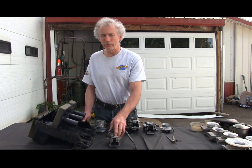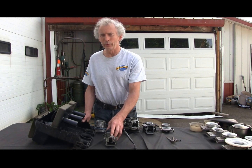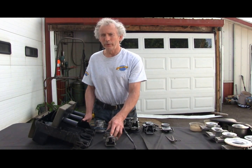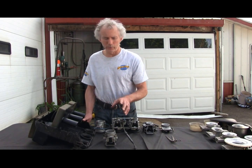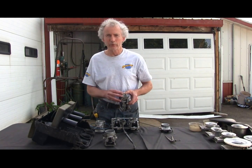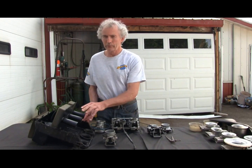For these guys advertising aftermarket airboxes on these new twins — the new twins are one to two jets rich. You put the aftermarket airbox on, you'll be a hair quicker. But if you take your stock motor, jet your carb — which is pretty easy — change one main jet in the bottom one size smaller, then you'll be way quicker with the airbox, plus you'll have the mid-range.